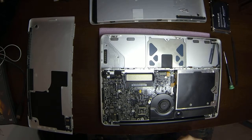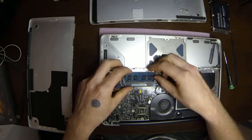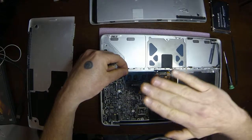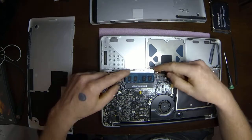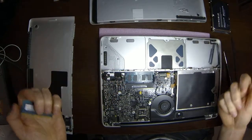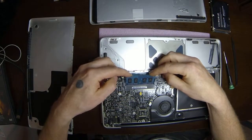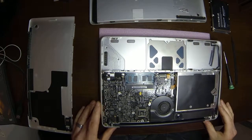So at this point we're going to put our replacement RAM in. They kind of go in at an angle. You want to put the bottom one in first — you want to make sure they're kind of stacked on top of each other. Make sure it's going into the bottom slot, just push it in a little bit so you can feel it's not pushing in any further. Then you just push down on the top until it snaps into place. Do the same thing with the second one — put it in at an angle until you can't push any further, then push down until it snaps into place. Voila! That is memory placement.